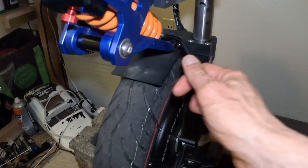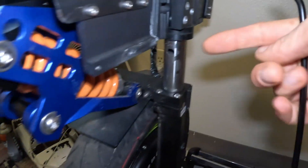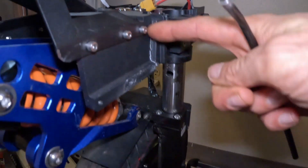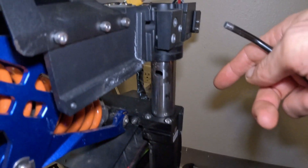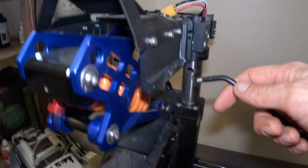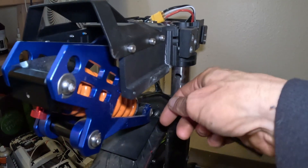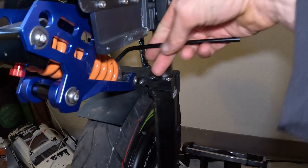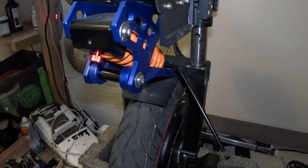The reason we're replacing the frame is because there's a nice crack here — my wife's T4 got away from me and smashed the frame. I'm probably going to have to pull this off and bend it back among a few other things. So we're starting with replacing the frame. First I need to release all the tension from the shock and back off the suspension all the way out, then unbolt it.